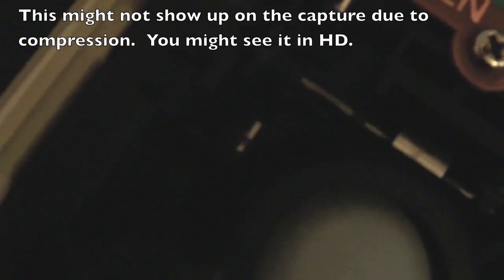I just wanted to show you here - if you're using a camcorder like this, I don't know if you can just about see - there's a little bit of pink there. Can you see it's a little bit pink? So I think we're actually capturing the infrared there. On this one here, you can tell quite clearly - can you see that one's infrared, that one's infrared. So it looks like it's the receiver or the chip, because we've got infrared being emitted from both of the output diode parts. So it must be the receiver. I might have a spare one, otherwise it's going to be finding another faulty mouse - maybe from an Amiga or an ST - and taking the component out of that.